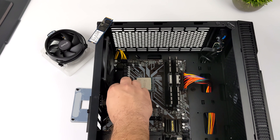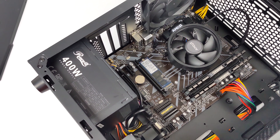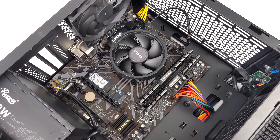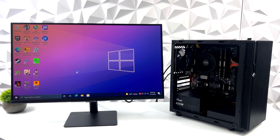I'm almost done with the build — I just need to get the drive installed and the cooler mounted. Once that's finished I'm going to install Windows 10 Pro on this machine. It's a very plain Jane build and I really wanted to keep it as cheap as possible — under $380 with the 5600G, 16GB of RAM, and one of these cheaper B550 boards. I've installed Windows 10 Pro, got some games, emulators, and benchmarks ready to test. I like to do some tweaking on the iGPU and RAM side of things, and it's actually really easy to overclock the iGPU on the 5600G using that Gigabyte board. We're going to take this 3600MHz RAM up to 4000MHz.